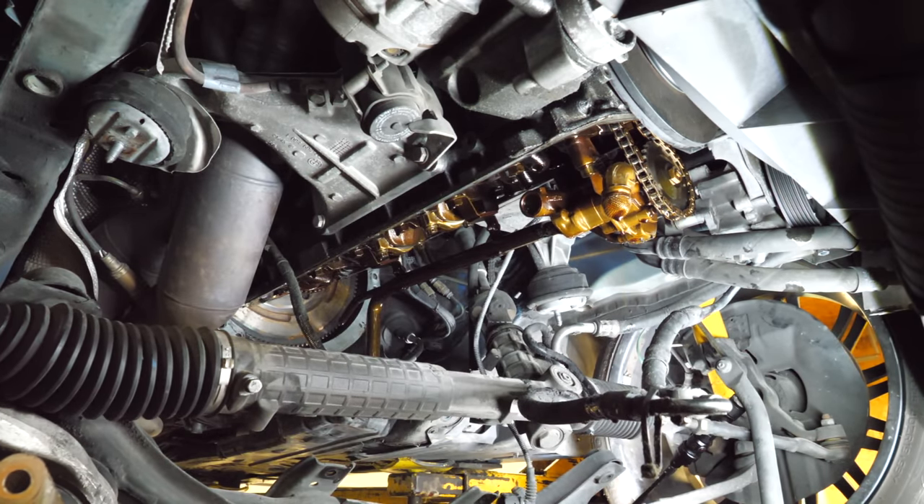This is reverse thread. In order to get the pan all the way back up you have to remove this little sub-screen — probably should pull that down before you drop the pan. I didn't do that. There we go, so now we're up. Now it's time to torque down the oil pan — these are torqued to 89 inch-pounds.